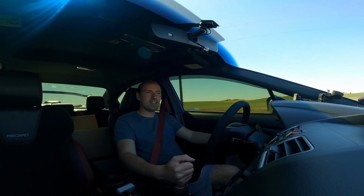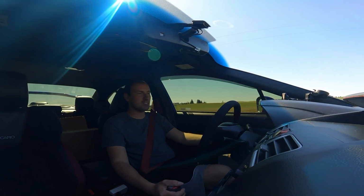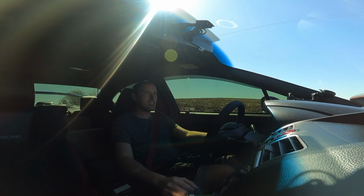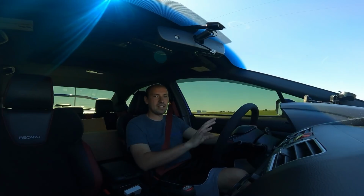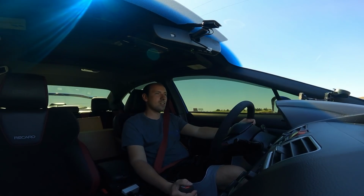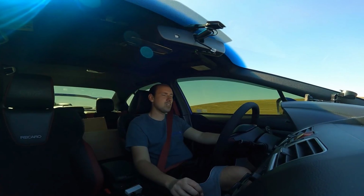This car also has an ACT Extreme Duty street clutch in it, so it does drive like stock. It has a factory flywheel in it. That is one of the biggest things I tell you guys to do, is to use your factory STI flywheel or a factory WRX flywheel with an ACT clutch. Otherwise, you're going to get that rather annoying clutch chatter. So when you use the factory flywheels on them, the car feels butter smooth.